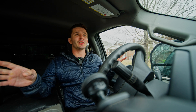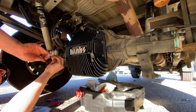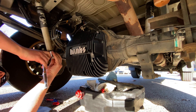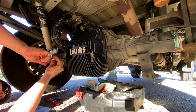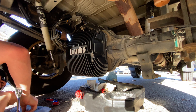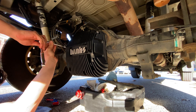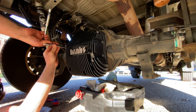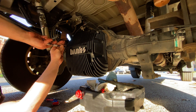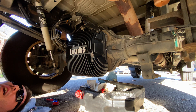These are Ford's recommendations that I'm following, though I think you could do it more often. I'm actually going to try to do oil analysis on my differential fluid, because I haven't seen anyone do that on YouTube. Running oil analysis on my engine has really opened my eyes — you can say intervals all you want, but you really don't know what's going on with that oil until you test it. Right now I'm running AMSOIL 75W140 in my rear. I have a Sterling 10.5 axle with no locker or limited slip, so that's what was recommended by AMSOIL and Ford for my axle.